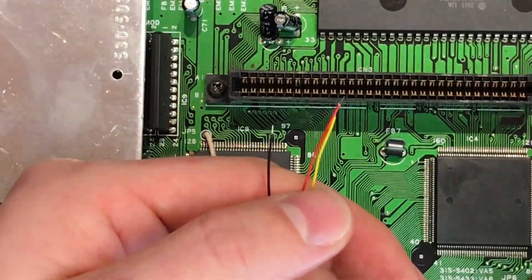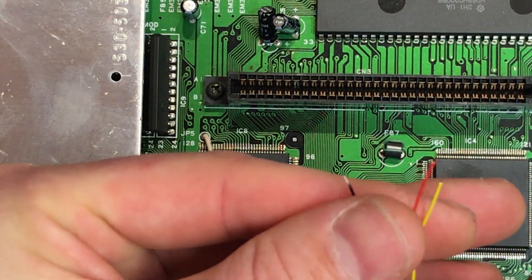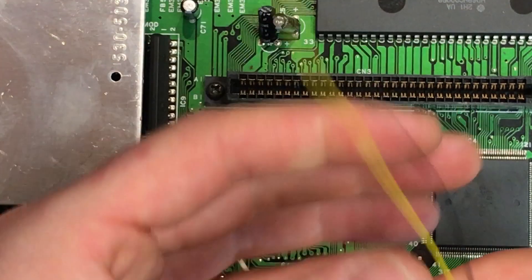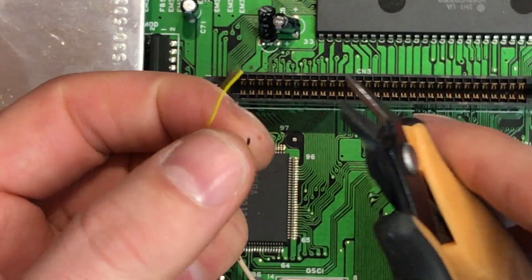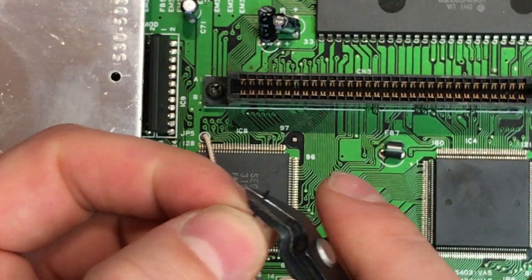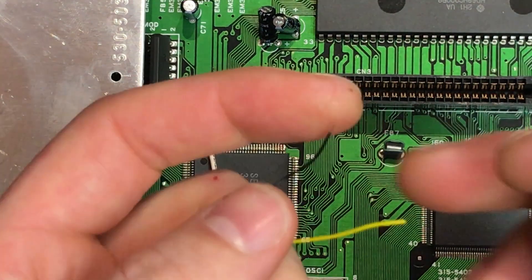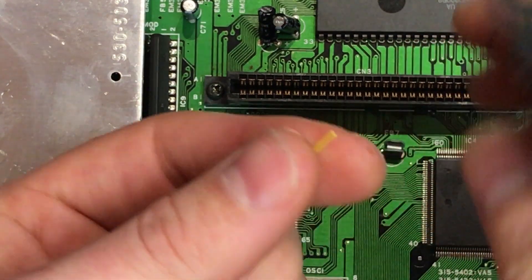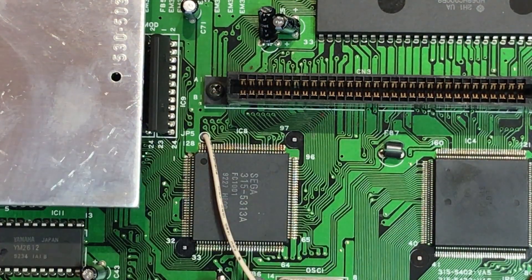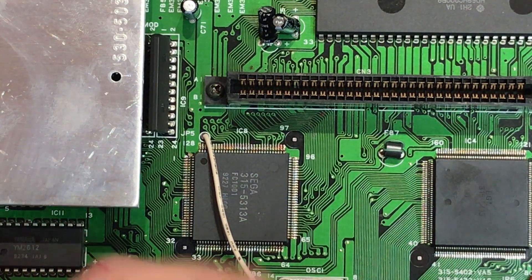You've got your three wires - prepare them by stripping the ends to expose the center core. These fine wires are single core, really easy to work with. To strip them, use your side cutters facing inwards - flat edges to the outside - pick your distance, very gently squeeze and pull off the casing. You don't need wire strippers for this stuff because it's so fine. We don't really need to tin them - just make sure they get good solder penetration when we solder.